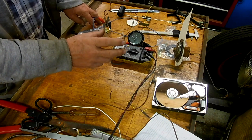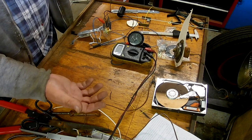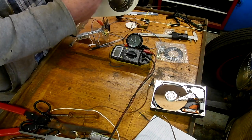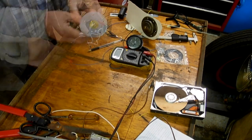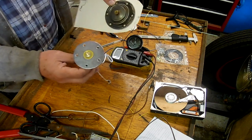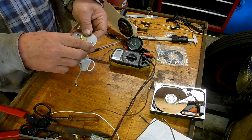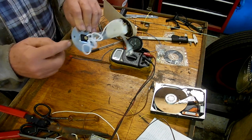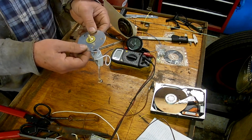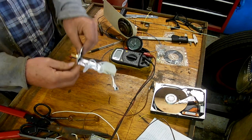I've got a little three-gauge cluster in the truck and there's one space available, so this can go in the other space. It was cheap — about 11 pounds delivered to the door. The bolt pattern doesn't match though. It comes with a pattern that must be some sort of standard, and I've got a different one. Rather than make a six-bolt to five-bolt adapter plate, this is just a piece of metal that's bolted on. I'm going to make a new piece of metal with the correct holes and just bolt the unit through the middle.